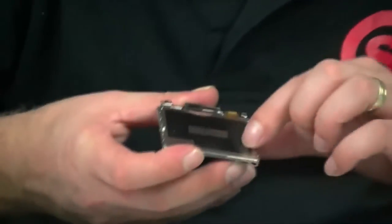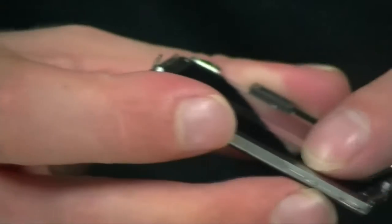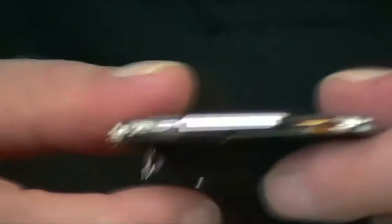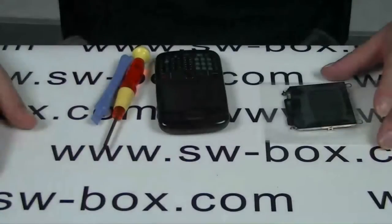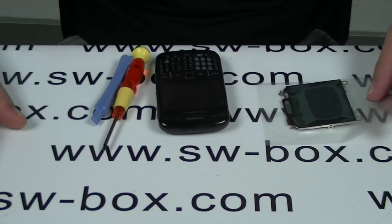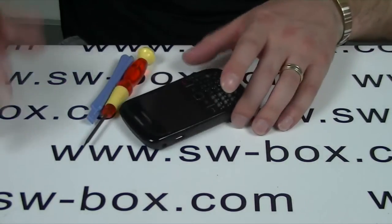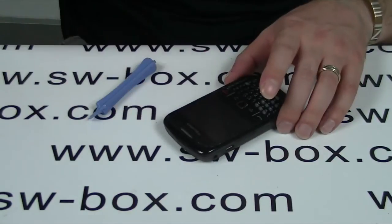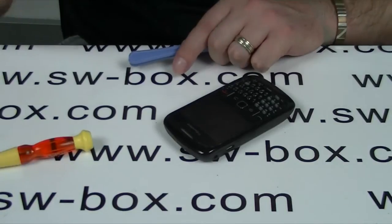There's also a sticky patch here — you have to take off the plastic film, and then there is a sticking patch there which helps stick it to the motherboard, and then of course you've got the protection one on the front as well that you must remove. LCDs are different depending on the phone, so you've got to take it apart first before you order anything. All you need is a Torx screwdriver and a pry tool — or you can use a spatula or even a blunt knife if you're careful.